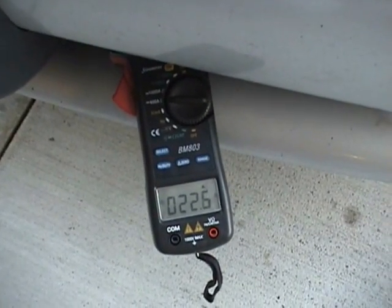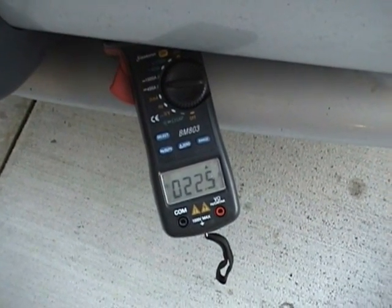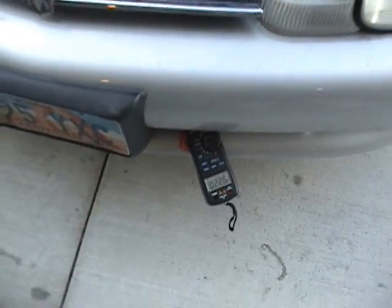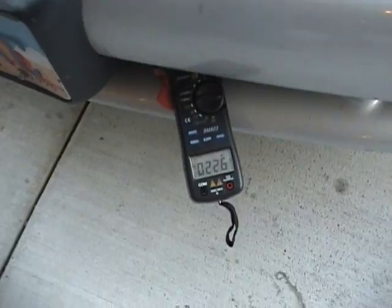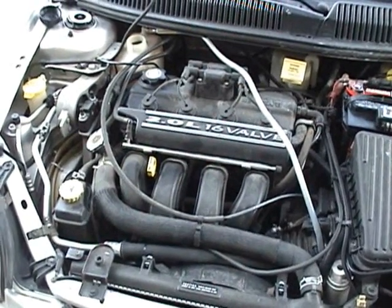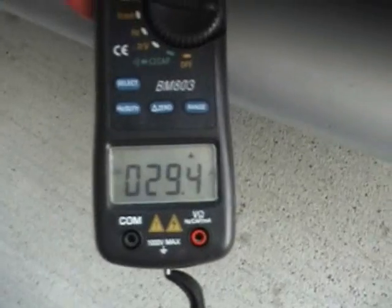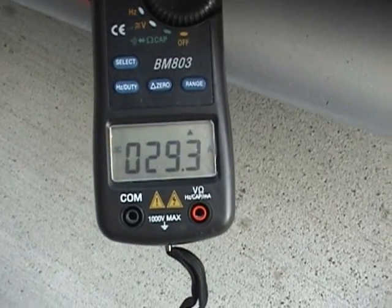The cell is running at 22.6 amps, which isn't near 2 liters a minute, so I'm going to add a little more sodium to the electrolyte. For this test we'll overdrive the cell a bit, right around 30 to 32 amps. Once I get it up to where I want it — we're close, about 30 to 31 amps is when my units produce 2 liters a minute — we'll go ahead and unplug the O2 sensor and run our standard mileage test route.